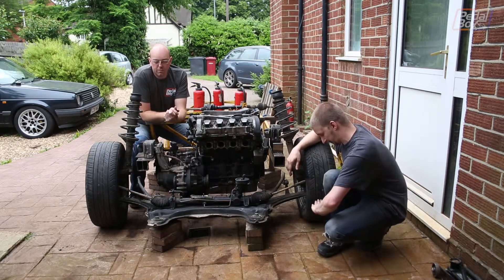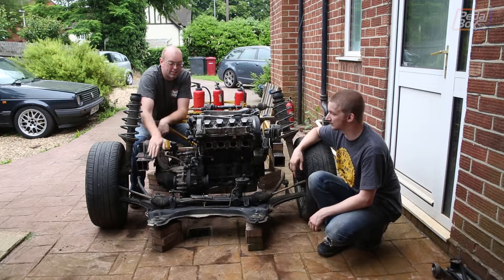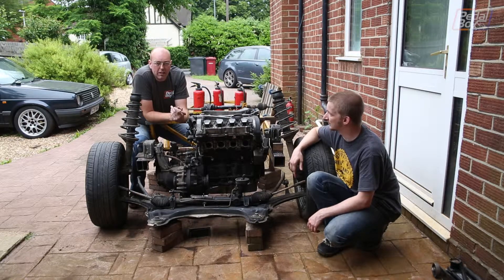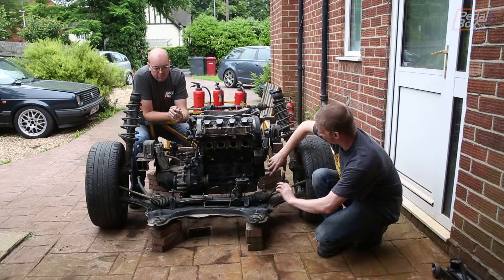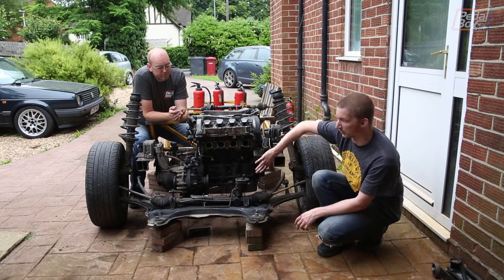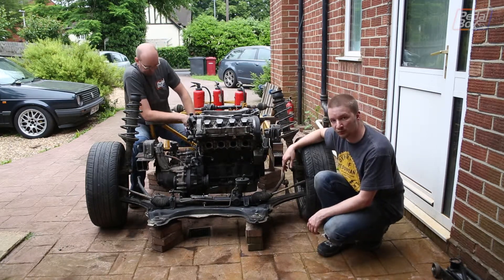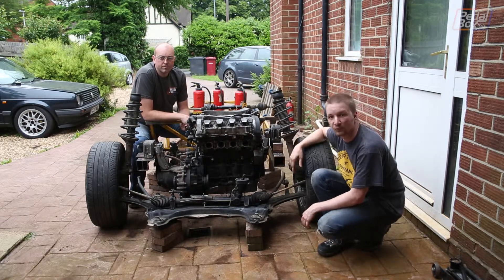But all of our mounting points are here and here, further back than any of our chassis leg, which I thought they might have been a little bit closer, and they're really not. So really, we need a better idea. Rather than building some massive spiderwork frame round the back, which would get in the way of all of our exhaust and engine and everything else, it would be nice if we could just mount all of our stuff further forward and have all the suspension mount underneath the chassis leg somewhere.